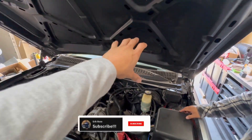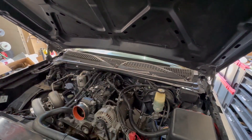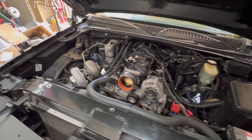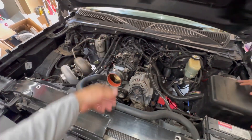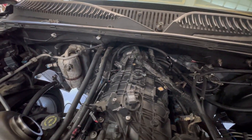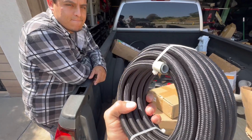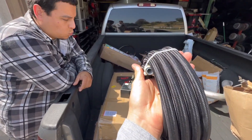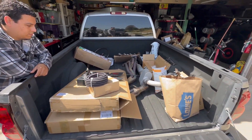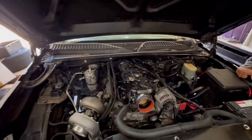Back there all you need is the fuel pump, E85, and then a fuel filter. We didn't change any of those lines — it's not exactly plug and play, you still have to do fittings and stuff. I do have videos of installing those in my older videos. Coming into the engine bay, the biggest thing you're going to need is PTFE line. I'm upgrading to AN8 — the one I currently have is AN6. As you can see, this line has a plastic lining on the inside so E85 will not eat it away. I used about 10–15 feet; 10 to 20 feet will be fine.